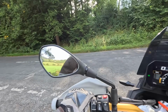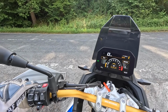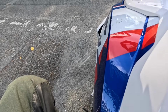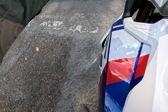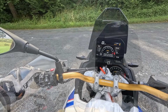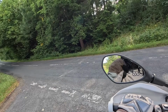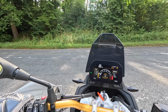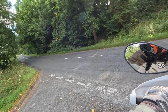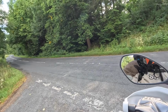Yeah, you see, you can't stop it. Slightest hill, it's away. So you've got to really choose where you decide to stop. If you put the side stand down, it's in gear, it stops. But you're no further forward because it's still going to roll away. And then it says engine not started, clutch not actuated. So you have to pull the clutch in and then it starts. Now you can let the clutch out, but nothing happens, of course, because we're under 2,700. Okay, so off we go.